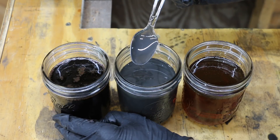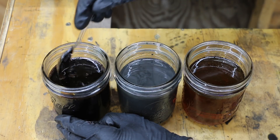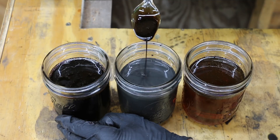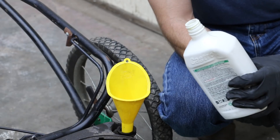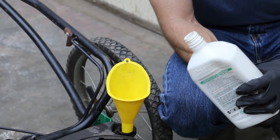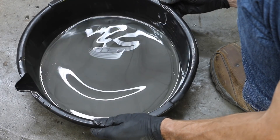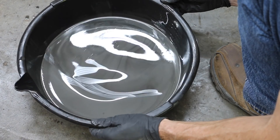I'm going to drizzle a little bit of this black oil into the silver and you can really see the difference. I'm going to add regular oil right now because I need to flush out a lot of the metal that's inside this engine. The oil is still very metallic, so I'm going to add some more clean oil and run it again to see if I can clean up this oil and get all this metal out.